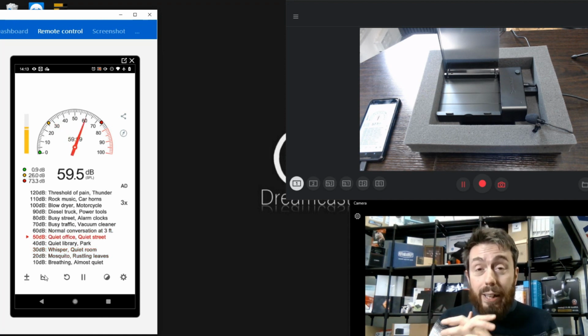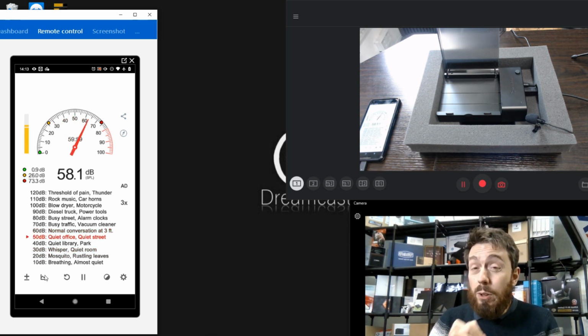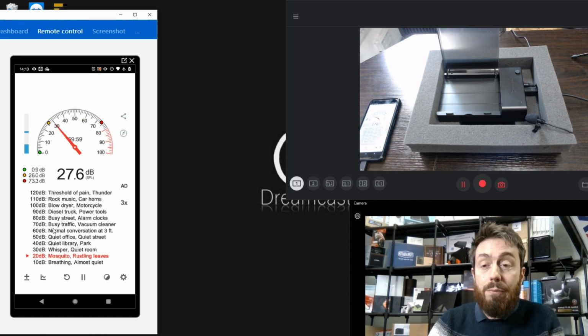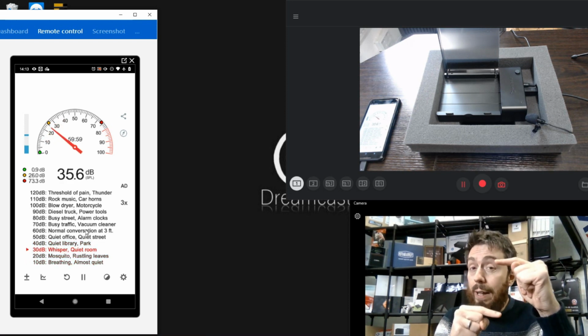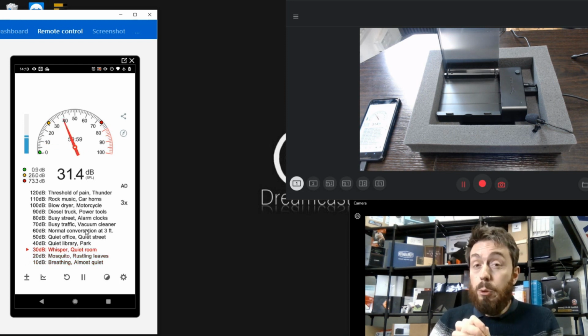So as you can see, we're not going to get a great reading because it's living almost consistently above that 30 dB, which is going to be no good for us in this testing. So what we need to do is go into here, and that's why we bring it down, just like my other videos, down to 25. And from 25, it will allow us from there to get a far more precise reading. By precise, I don't mean the numerical value so much as the difference between background and the drive itself. So if we're quiet now, this will allow us to differentiate between the clicks, hums, and whirs of the drive a great deal clearer.